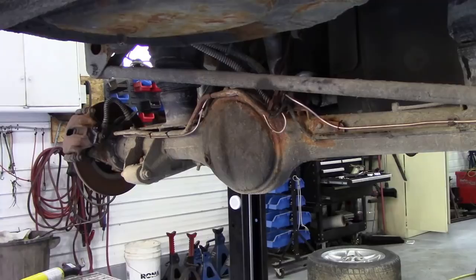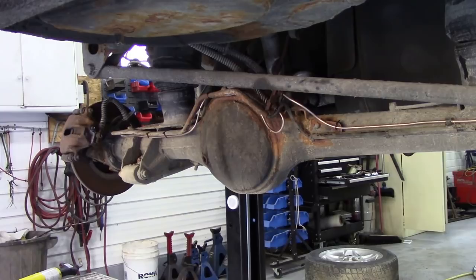So I got the brake pipes on late last night, got them all fed through and bled, and everything was fine. The only thing I don't like about cunifer - the nickel piping - is it's kind of difficult to get it in a straight line. Bends lovely, but difficult to get in a straight line. I had a bit of a problem trying to bleed them through. I had my vacuum pump on, trying to suck the fluid through. I eventually got it through, and I found out the cap was blocked - so I couldn't get anything through. Hopefully that'll work now.